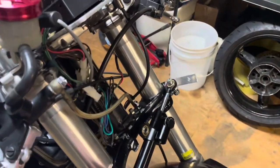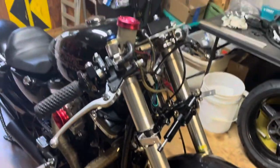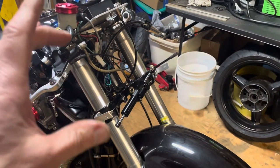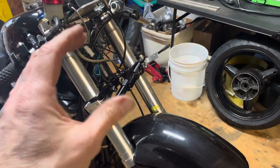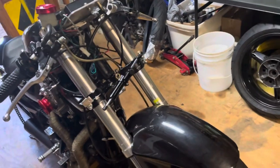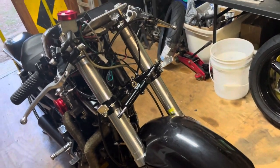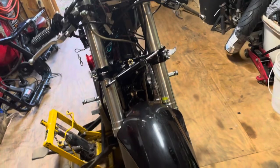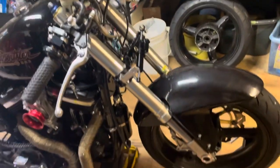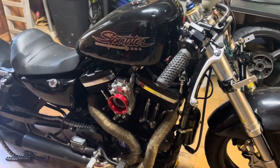It's probably always a good idea to go ahead and put a steering stabilizer on a bike if you're going to put a front end other than what Harley-Davidson intended — it doesn't change the rake. But with the bearings the way I've got this set up, I really don't have the option of putting extra tension on the bearings. I've got it pulled down as tight as I can get it with the top nut, and it's not going to fall apart or anything — it's not dangerous — but I may not be able to address any head shake by tightening up the steering stem bearings. I don't really have that ability.